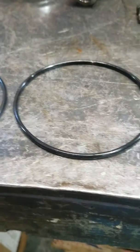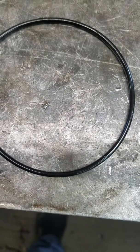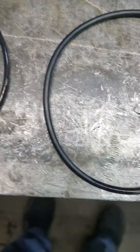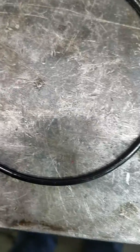The pictures may not come out clear enough, but you can see how the o-rings were overheated and the previous shop didn't replace the o-rings. See how round and circular these are compared to how oblong the others are. These are the two clutch pack outer o-rings.